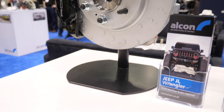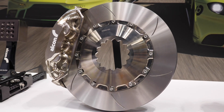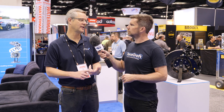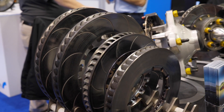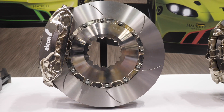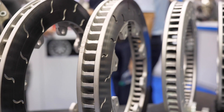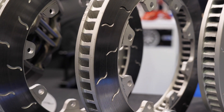In motorsport applications, most rotors will have some form of slot or groove, but not all slots or grooves are created equal. The basic function of the slot is to help get rid of the gases generated out of the pad, the dust, and it helps with the initial bite of the pad. The different designs have evolved over many years — you've got the simple straight groove which works fine for most track applications. For street car based applications, single straight grooves can cause some distortion in the rotor and you might encounter vibration or noise. That's where you move to a segmented groove — a lot of smaller grooves around the rotor — so you're covering the pad in a more consistent fashion.